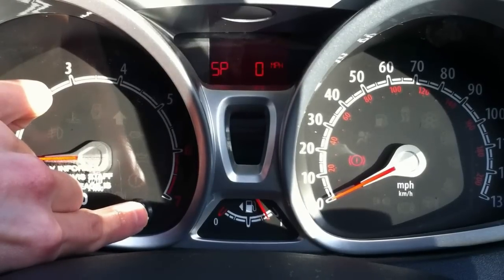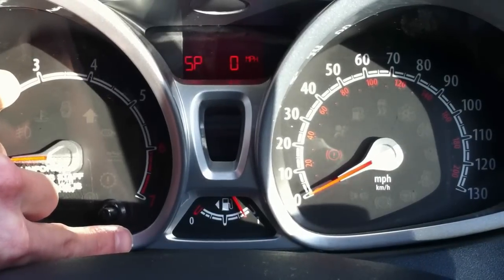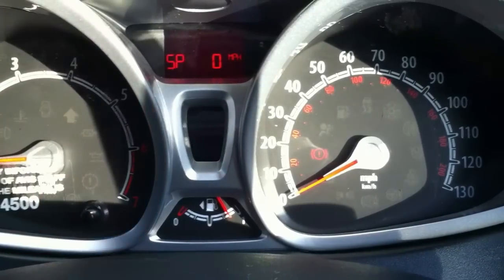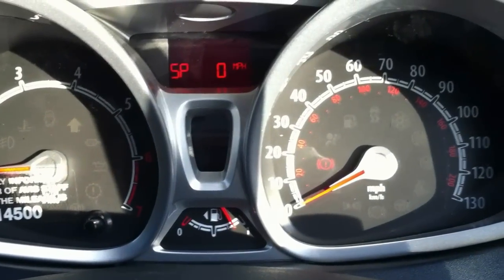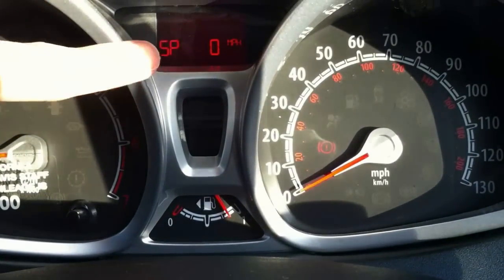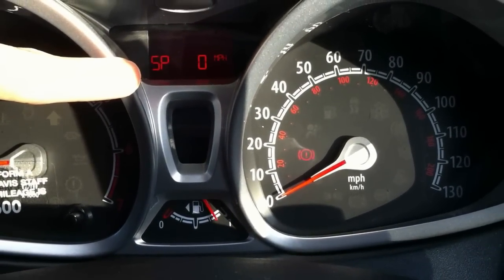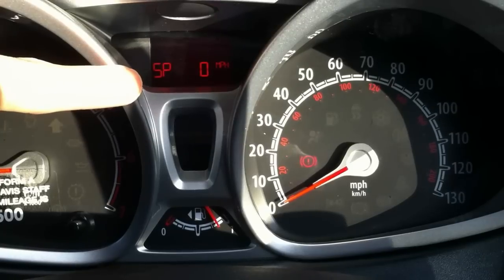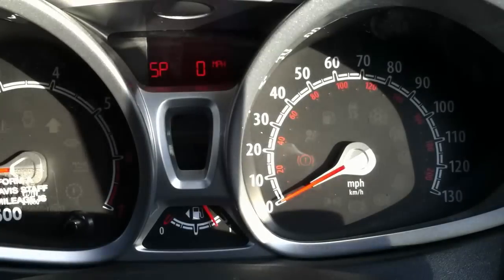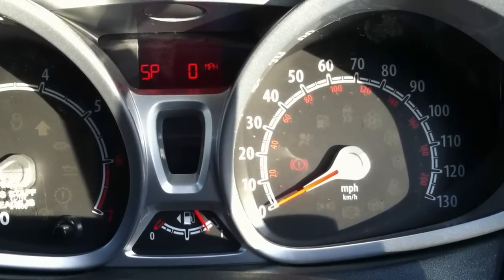Now I'm going to go through the options and the next one I believe is what we want — the digital speedo. This is an MPH speedometer, so we can leave it in this mode while driving. Just be aware that whatever value is displayed is in multiples of 0.1, so the display will read 300 when you're actually doing just 30 mph.